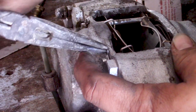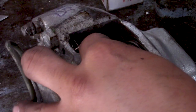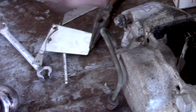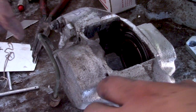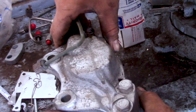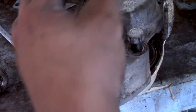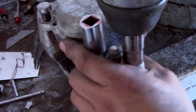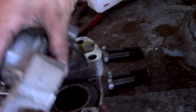You want to take these pins out that hold your brake pads in. Put those to the side because you don't want to lose them — don't want to lose any of the hardware. Next, you're going to want to take these two screws out and these two bolts out. One of them is 5/8 and the other one is 9/16. And simple as that, it falls apart. Spacer.